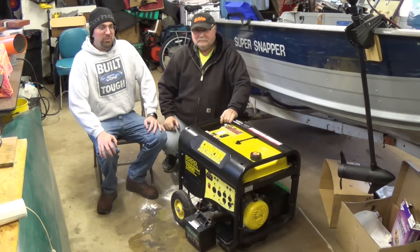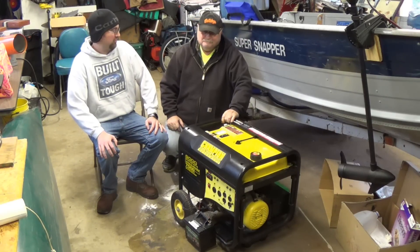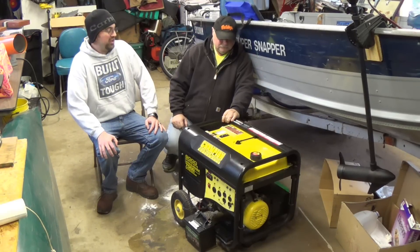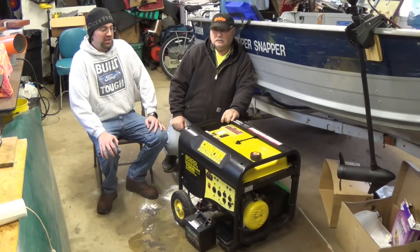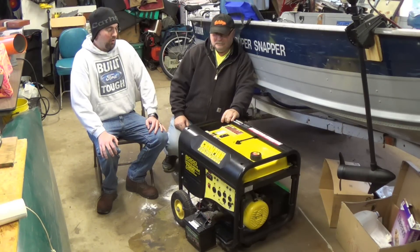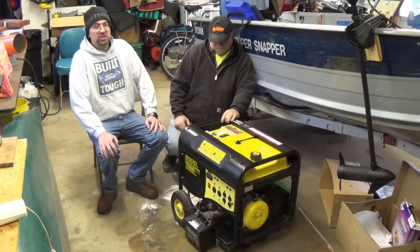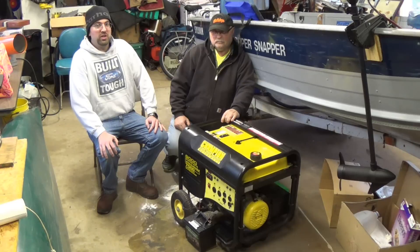Hi, I'm Eric and this is Paul and tonight we're going to fix Paul's broken generator. He had yesterday tried to do some maintenance, start it up, make sure it would actually start and run since we're starting to get some bad weather. It would start, run for a few seconds and shut off. Turns out the oil was overfilled with fuel — most likely a carburetor problem where fuel is dumping from the carburetor into the engine, draining down to the crankcase. So tonight we're going to pull the carburetor apart and fix that so it will actually start and run when we need it.